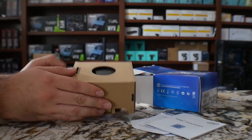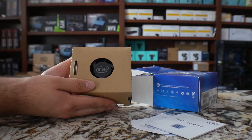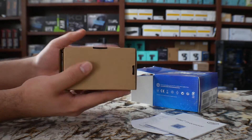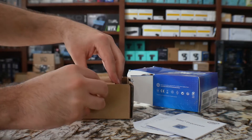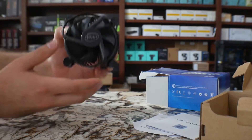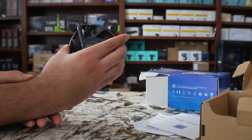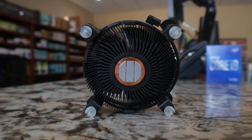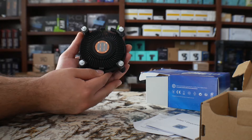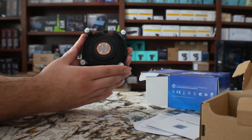Now as I mentioned, this processor comes with its own cooling fan. We do not recommend this for this processor — even though this is the 10900, we still recommend getting an aftermarket cooler. It doesn't have to be anything too expensive, but it's better to have something like that. That's the basic Intel processor cooling fan that they give you — it's blacked out; they used to be silver and some white. In the back, your usual thermal paste compound. We also recommend replacing that compound with your preferred third-party option. We like Thermal Grizzly, so go ahead and replace this with some proper cooling.